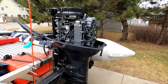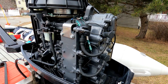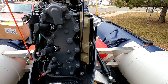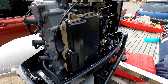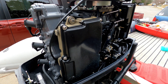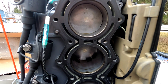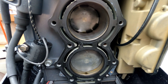This is a Tohatsu MX50D3 and we're going to put on the TSR high compression billet head. Compared to an M50D2, the D3 has a lower compression head and a larger gear ratio. We tried out the high compression head because we're not getting the full revs we need with the higher pitch props, and so that's what we're shooting for.